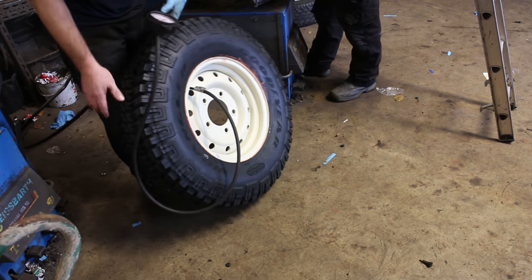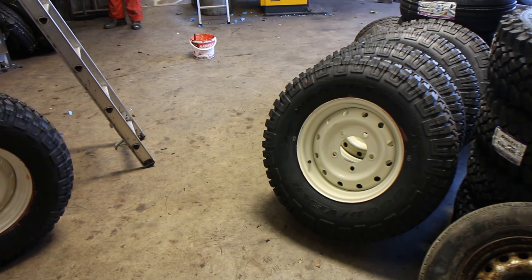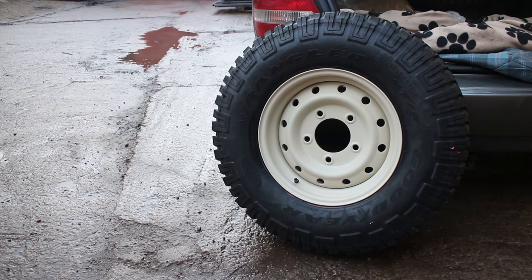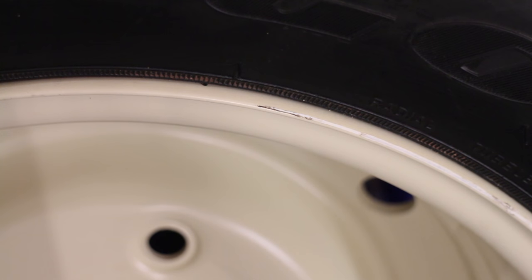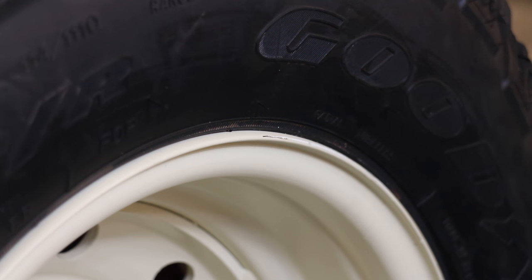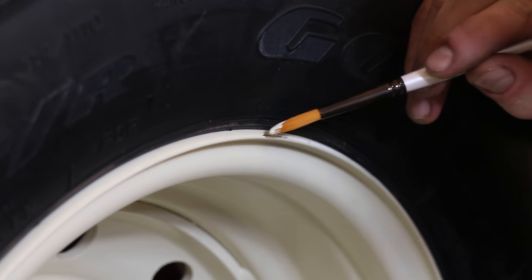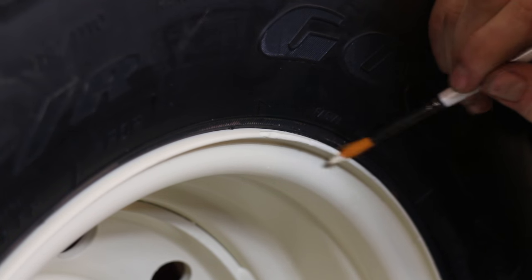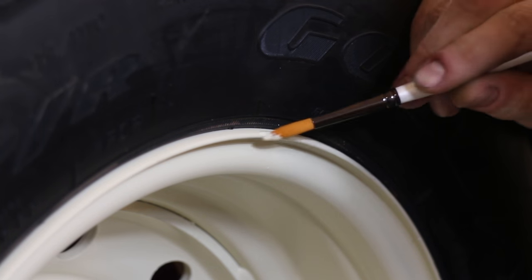I'm very happy with the wheels. The SIP Sapphire HVLP gun we used to paint them has given an effortless smooth paint finish — it's a top spray gun for the money and it's worked really well. The wheel fitting machine does sometimes graze the lip of the wheel, so using an artist's brush you can just go back and touch those in for a very quick and seamless repair.